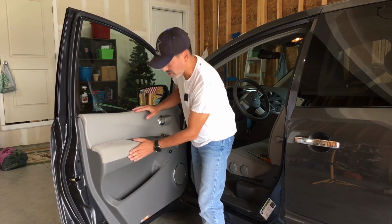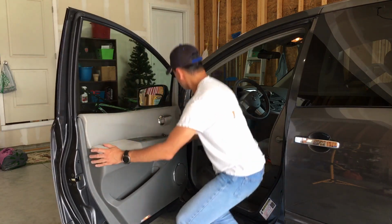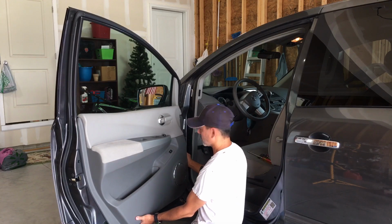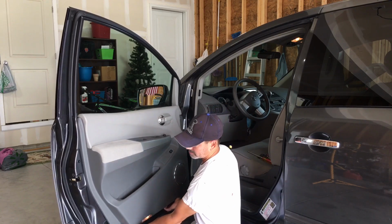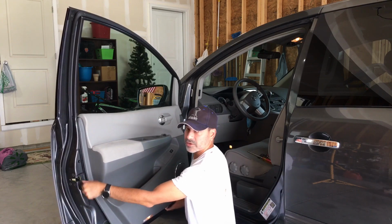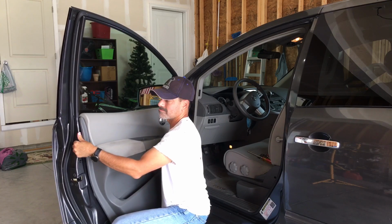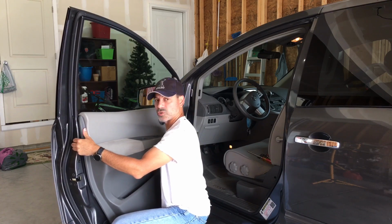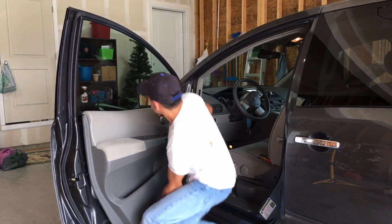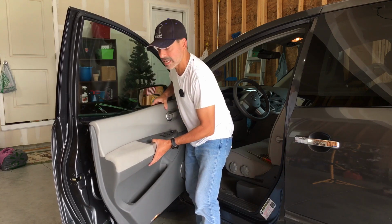Now that all of this is off, what we're going to do is just pull the door out to release the clips. So we'll just grab it along the edge here and pull it. You can hear that. Came off there. You should have another one here. There we go. You want to take your time because you don't want to break these clips. There's one up top here. Give it a nice pull. And then with this one, you want to pull and lift up. There we go. And now our door panel is now off.